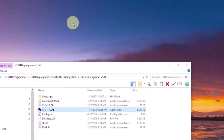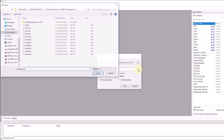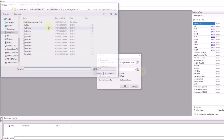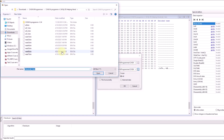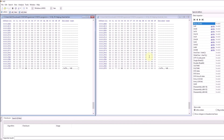What we want to do now is compare and make sure everything is good. Go to Data Comparison. Compare a8.bin and a8.bin.3. It's different — so let's check by comparing bin to bin.1. The last one is bad because we waited a long time — that's a problem. Always program or read in the first minute or so. Compare bin 1 and a8.2 — the first three are good, the last one is bad. The serial number difference confirms it.